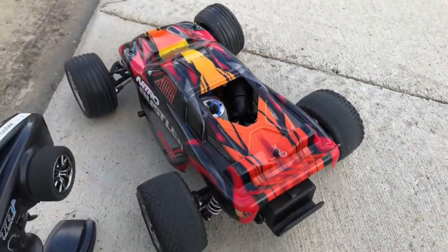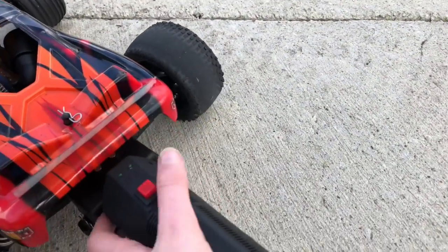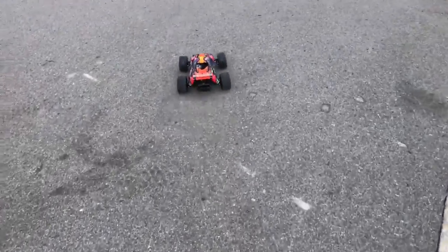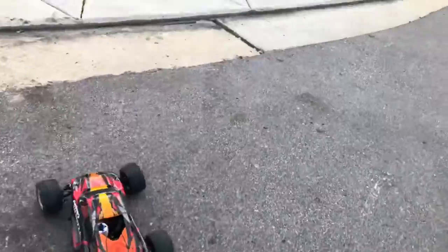It keeps stalling because I'm holding the brakes too long when it comes up the hill. Yeah, I definitely recommend that. Yep. Okay, I stalled it again. I wonder if it's getting too much fuel now. I'm gonna go back an eighth of a turn. I'll lean it. Eighth of a turn.